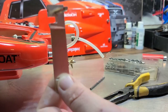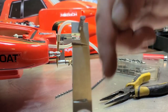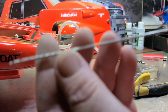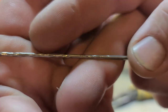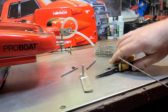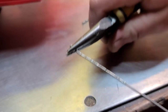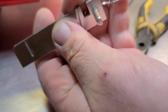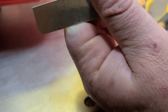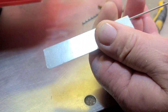To your pickup — if you don't have a drill bit that long and you don't have a long enough bit, you can drill it out as far as your bit will reach. This is a piece of stainless steel rod that I've actually just put on my grinder and roughed up pretty good — you see that? And you just put a small bend in it, like a little S-bend. Put it down in your rudder past your threads so you don't mess up your threads.